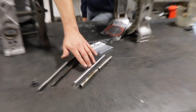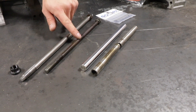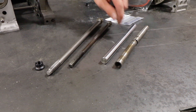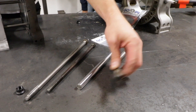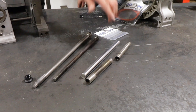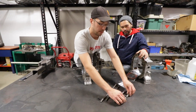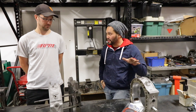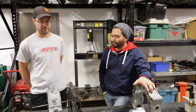The solid dowel pins are an addition to that. Some guys would probably just use the factory tension bolt and go to a solid dowel pin. As you can tell, the factory dowel pins are hollow and are in two pieces. So once you put the solid dowel pin in there, there's no chance of the motor flexing. So with the addition of these beefier studs, we can run more boost in this motor? Sure can — it'll hold it all together.